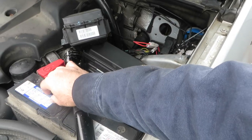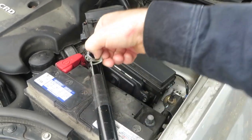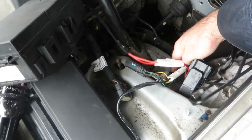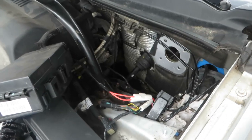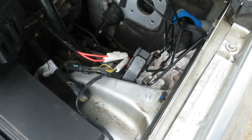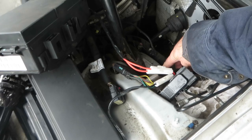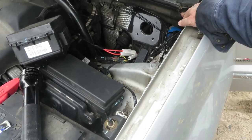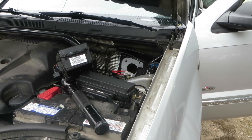I got the brake booster out now. The clip for the pedal is pretty easy - you just lift up and push it out. When you take out the brake booster, you need to get the bottom out first because it catches on the lip here, then you can slip it out from underneath the firewall. If you want to get the grommet sealed, now would be the time. I stuck a cloth in there to keep debris from going into the vehicle. The CRD has a lot of insulation under the hood which makes it difficult to get in and out - this is also a North Edition which has a bit more insulation.